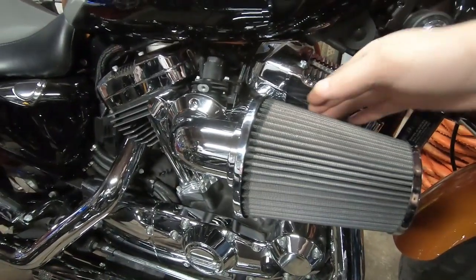Aside from being locked into an air cleaner and no mention of the oil pump drive gear, they make no mention of lifters either. They sell screaming eagle high capacity lifters for almost $289, and just looking at the advertisement it appears they just have larger needle bearings — that's pretty steep. And it gets better: reading reviews on the kit, I noticed it made no mention of push rods. A guy bought the kit and found out he needed a set of their 'perfect fit' push rods, which are screaming eagle adjustable push rods — and they don't come in the kit.